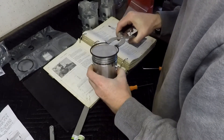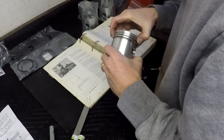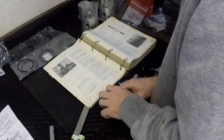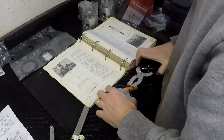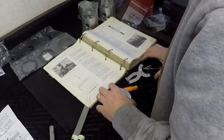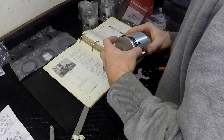I used a ring expander tool — I'll put a link in the description. It's very inexpensive and in my opinion you need to have it, because you take the chance of breaking the ring without it. Even though the rings are sprung metal, if you try to slide them on without the ring expander you could snap it in the twist. I picked it up on Amazon for about seven or eight bucks — cheap insurance when a set of rings runs you 40 or 50 dollars.